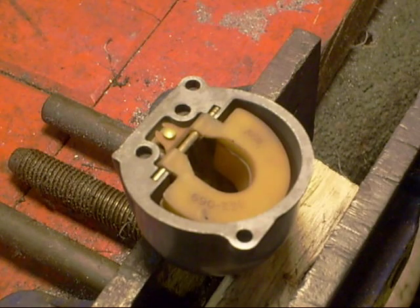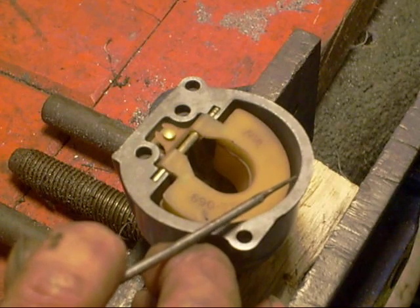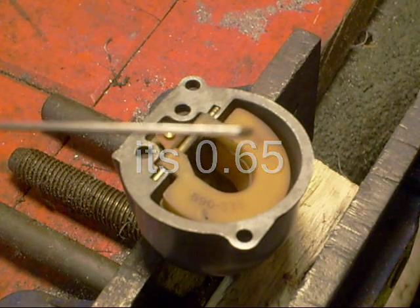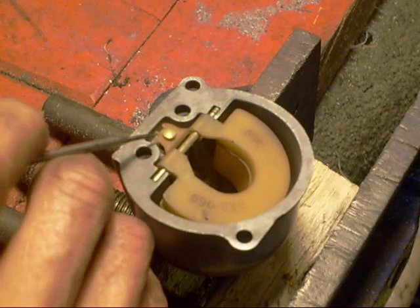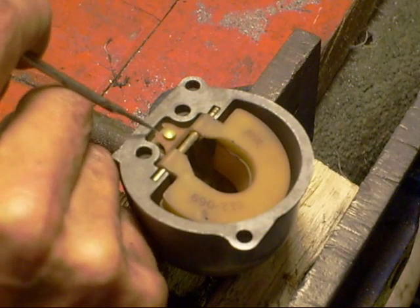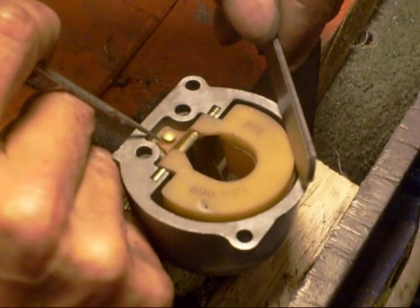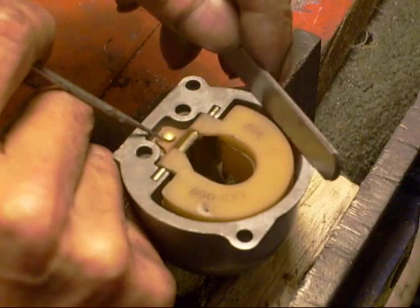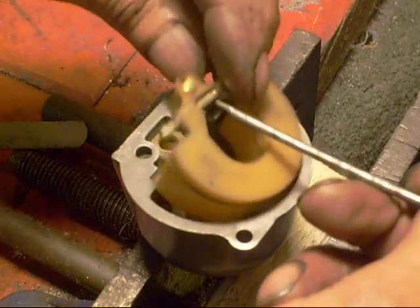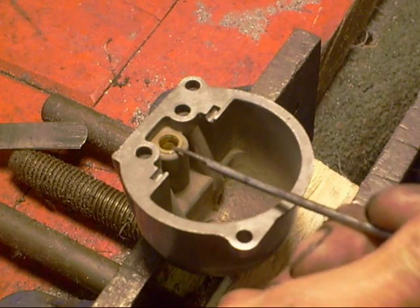What we're after setting this gap is approximately 60 to 80 thou distance here. Now there's no tangs on these and the needle's downwards, so you have to just put a tad of pressure on there. As we see here, it's too high — it's got to be 60 thou below this surface. And the only way we can do it is by removing this seat and lifting it.